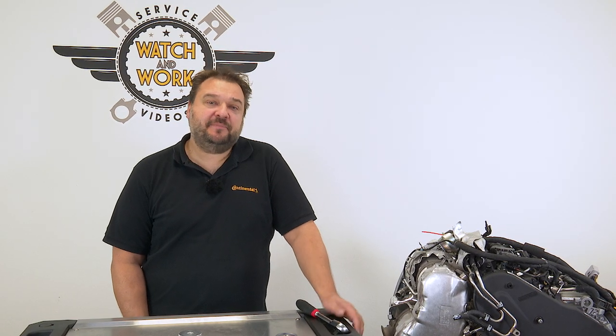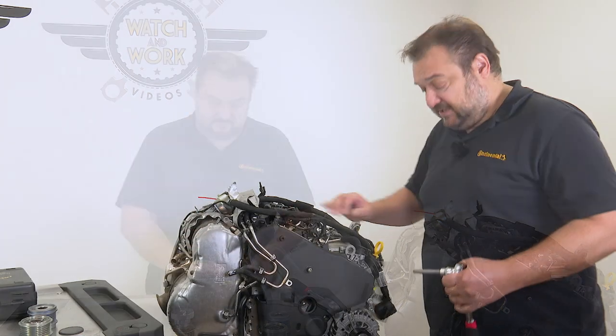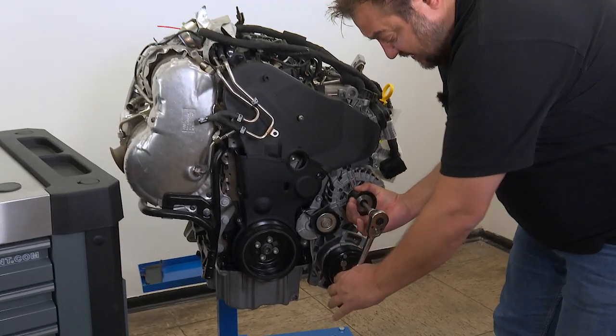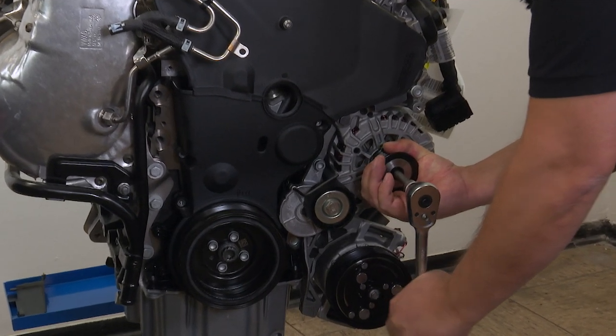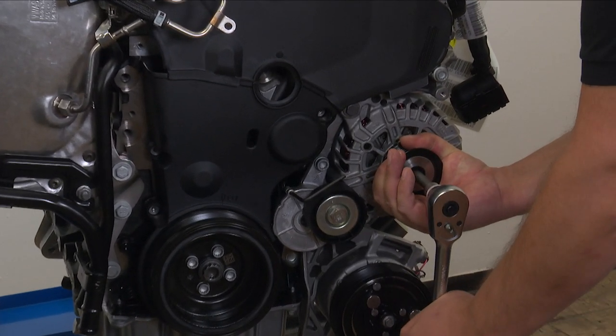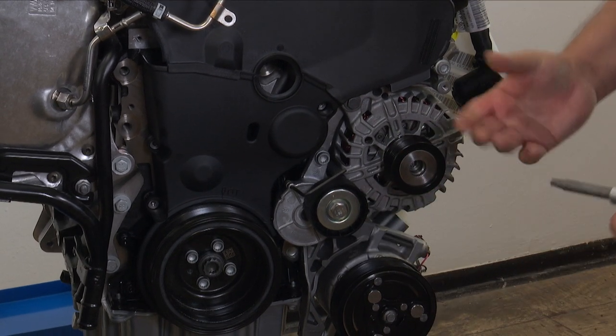Now back to the workshop. If you have an engine with an OAD instead of an OAP, you'll need a special tool that you'll find in our OAP toolbox. You use this to turn the alternator shaft in a counterclockwise direction while holding the decoupler's outer ring in place. You should feel the spring yielding. If the spring doesn't yield or the decoupler doesn't slip, it means it's faulty and must be replaced.